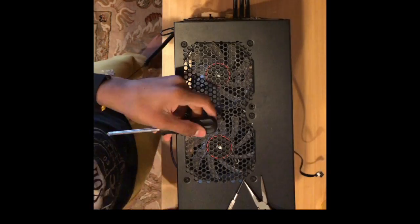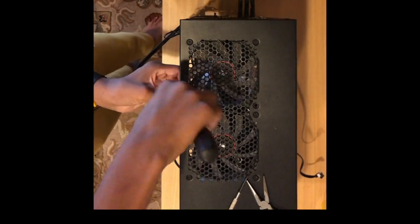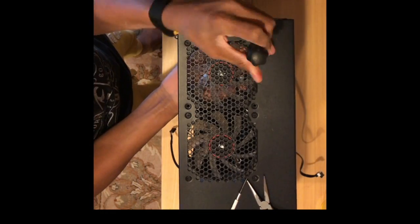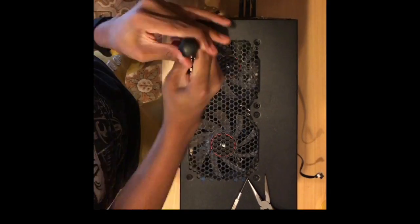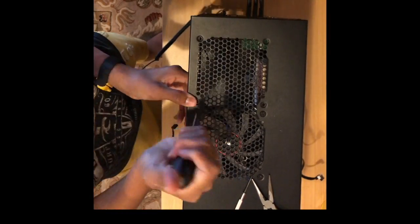As you add more voltage to computer parts, there's more heat generated. If this heat is not exhausted quickly, your PC will become very hot and crash, and this will not allow for overclocking. Overclocking is just taking the frequency of a CPU or GPU, graphics processing unit, or a central processing unit, and increasing the cycles per second.